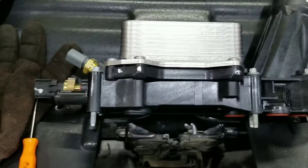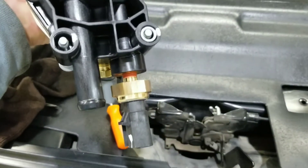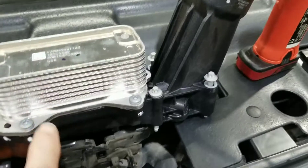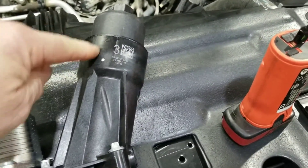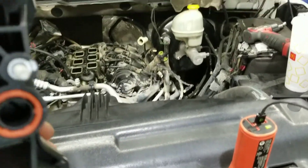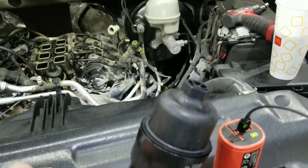Here's what it looks like in its full form. When you flip it upside down you'll see the o-rings that leak. The Mopar part has both sensors on it. This silver thing at the top is the cooler — coolant goes through it and so does some of the oil. This is where your cartridge goes for your filter. You've got to torque this thing to torque specs. There's an o-ring on it — put some Vaseline or white lube grease on it — but make sure you torque it in the right torque sequence and the right torque spec. It's in inch-pounds, so make sure of that.